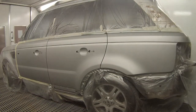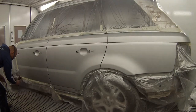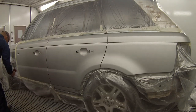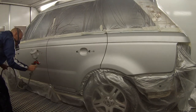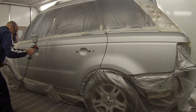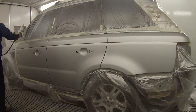What I'm doing here is using a blending clear, which is just a clear base coat. The thinning ratio is one to one — same amount of reducer as blending clear — and then straight away you put your final effect coat of base coat on into that wet coat of blending clear. I've found it blends in nicer if it's wet when you're actually putting that last coat of base coat on.